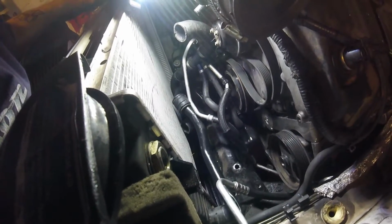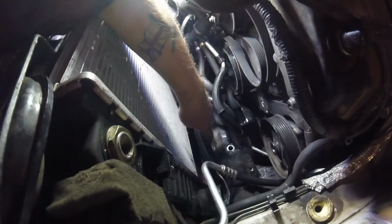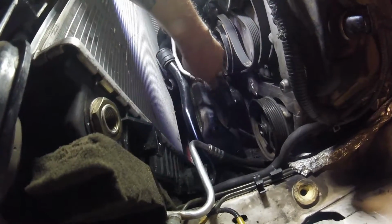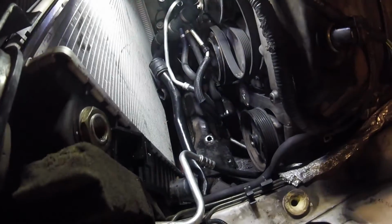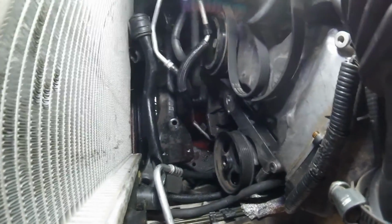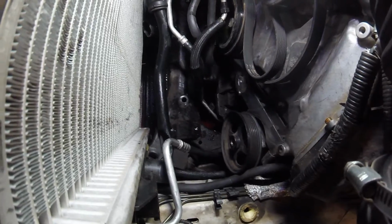You have to remove the radiator shroud, which means obviously you have to remove the expansion bottle, which is a real pain in the butt. Look out for all the various connections and bolts holding everything in place, and stupid plastic clips. You need to take this top cover off so that you can get the top hose out of the way. You need to disconnect the transmission lines from the radiator, and you need to disconnect and move the sway bar. That gives you enough room. You then pull these transmission lines over and out of the way, and then you spend the next 3 hours wiggle, jiggle, piggle and diggle to get the compressor out through that gap.